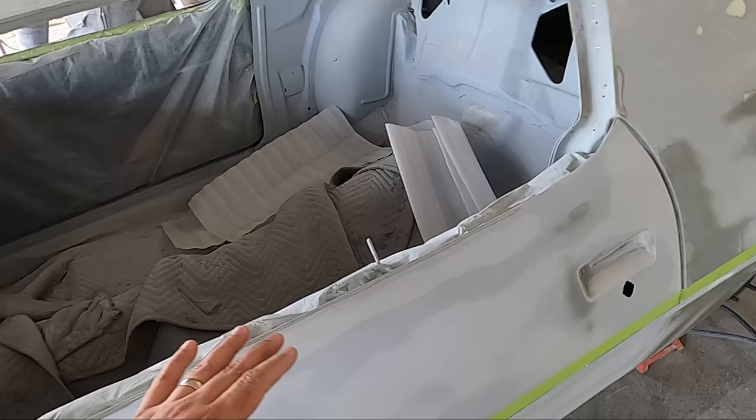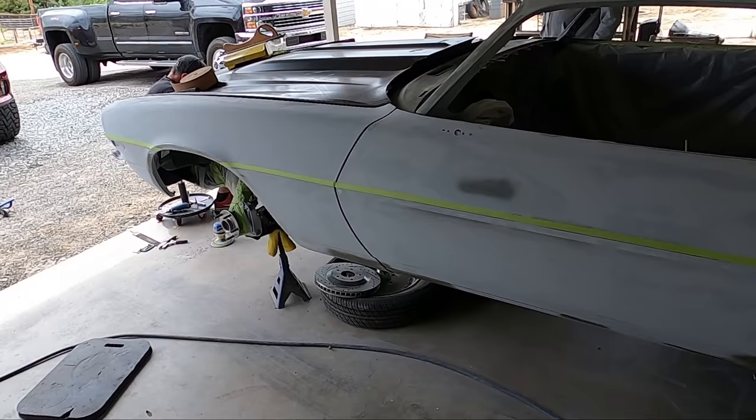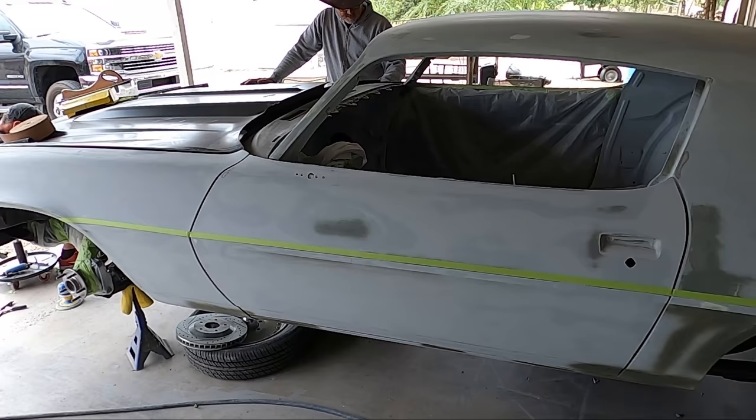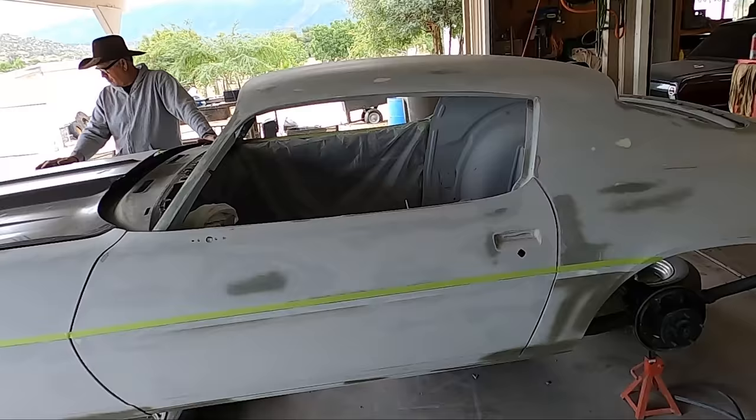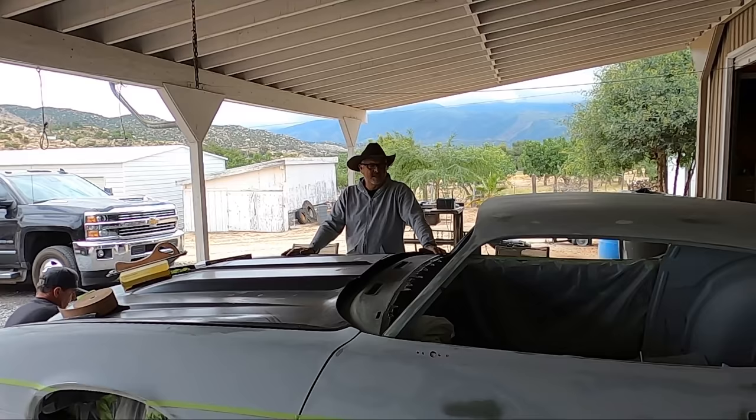We'll probably just keep a cover on the car, but it'll be nice to have glass in the door, finish all the locks, and get everything mounted. She's just about ready for paint, we're getting there. Craig's finishing it off in 320 right now, and at that point we're handing it off to the painter. The car is getting painted down in Escondido. Once we get the nose finished and touch up all the areas in 320, it's time to blow apart the car, touch up the back ends of the doors and all of the jams. Then bag it and tag it — bag everything so you know which spacers and bolts went where.